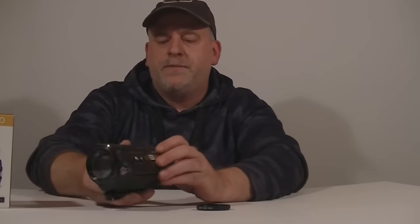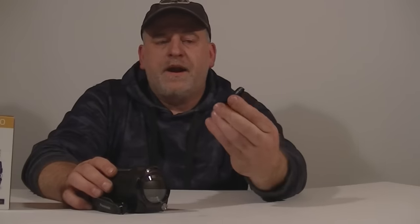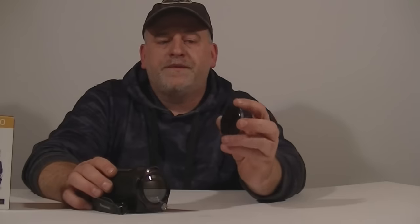What you're looking at here is a night vision capable Panasonic W850. There are a lot of cameras out there that have night vision on them, and they're all pretty much the same anymore — once you're in night vision, you cannot adjust any settings other than focus. If you're outside during daylight, they will wash out terribly; basically you see a white screen or a bright green. One way around that is to buy an IR filter — preferably the higher the better. This is a 950 nanometer IR filter.